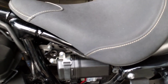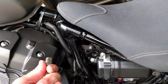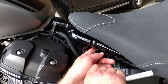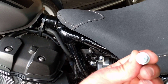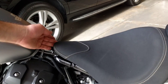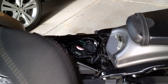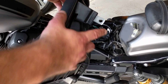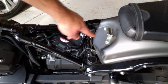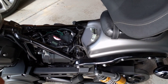We're going to remove this bolt with a 10 millimeter socket — not a racket, sorry! Stick it in with the extender. The bolt is kind of tight when you take it out. To remove the seat, just lift up and pull back. This is the only thing that connects it — the back lower hook holds it in place — and it kind of pops underneath. Very easy, very simple.